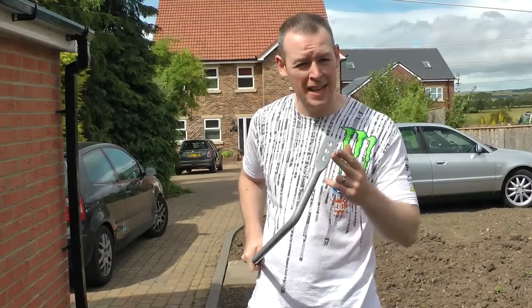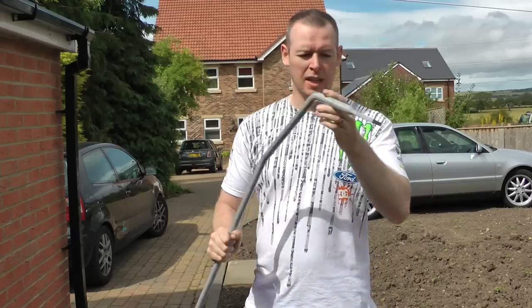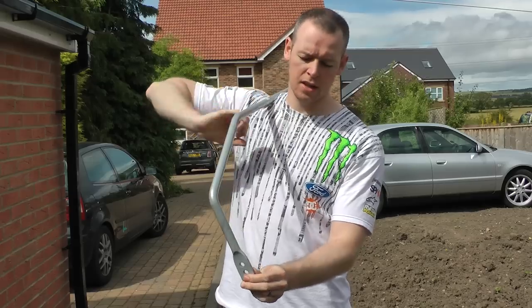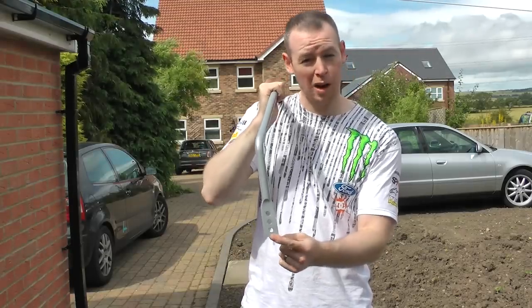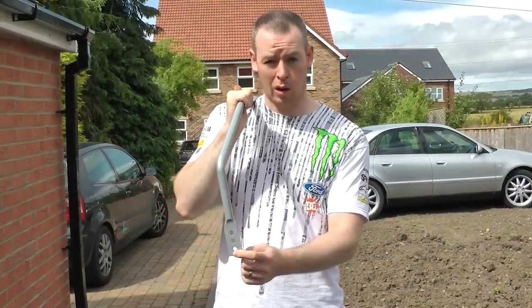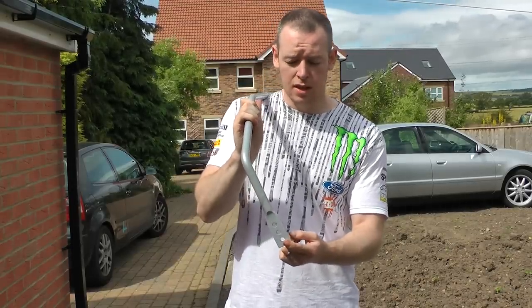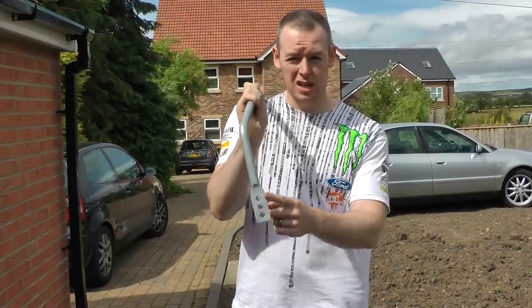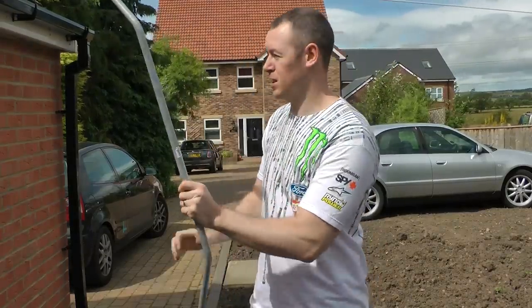Although this kit is the BWR19Z, this is actually the 20mm blade adjustable bar. You can see from the pins on the end, you can adjust the hardness or harshness of it. The pin furthest away from the bar is the softest setting, which is where I'll be putting it, because I am a clot when it comes to driving dynamics. The hardest setting apparently will completely cure understeer, but may also put you in fields, which we don't want. So, let's fit it.